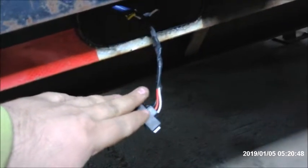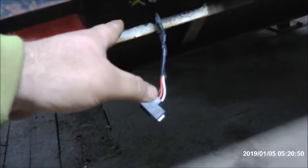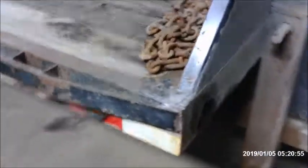We tap into it here for a marker light. And then we tap into it again here for the beacon. This is actually a four wire, terminates here, and it turns back into a two wire again. And then it comes up into these two clearance lights.